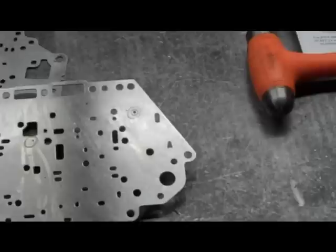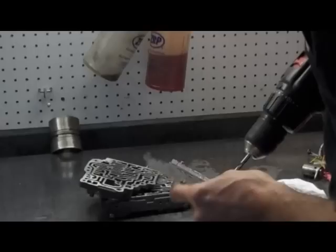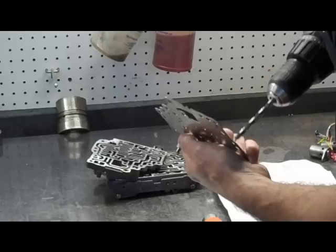This is what it's supposed to look like when it's done. At that point I'm going to get another drill bit, and all these holes that I've drilled, I just give them a quick chamfer on both sides. I'm not going to interfere with anything, but it's just a nicer way to do it - it's just a habit I've been in over the years.